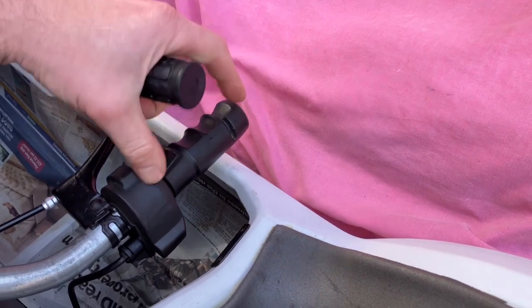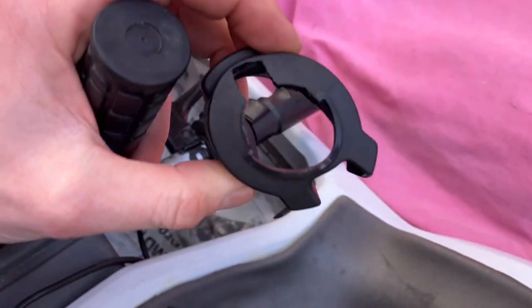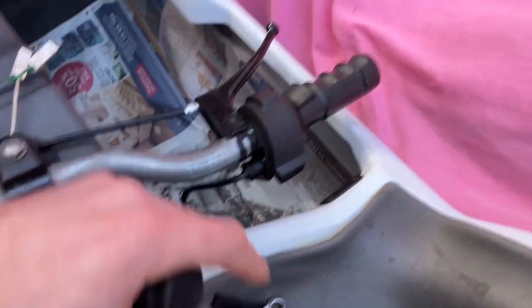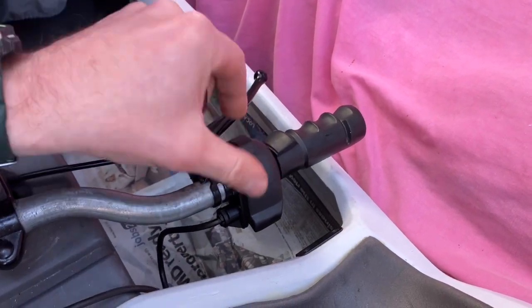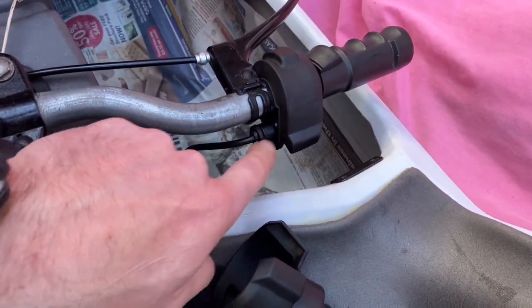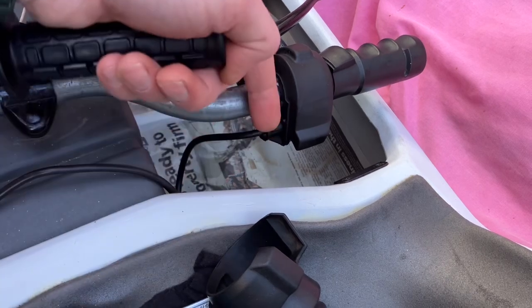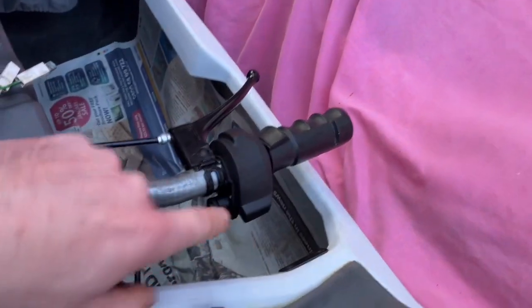I cut off about an inch of plastic roughly to make sure this installed correctly. I had two tatty grips, both with wear markings on the side from rubbing. I cut off the worn part with a blade — really easy. I then practiced different techniques of mounting the rubber piece, trying it various ways, and ultimately found you have to have the wiring part down at the bottom because it can't be too far forward otherwise it hits the bolt, and you want the right angle for turning circle.